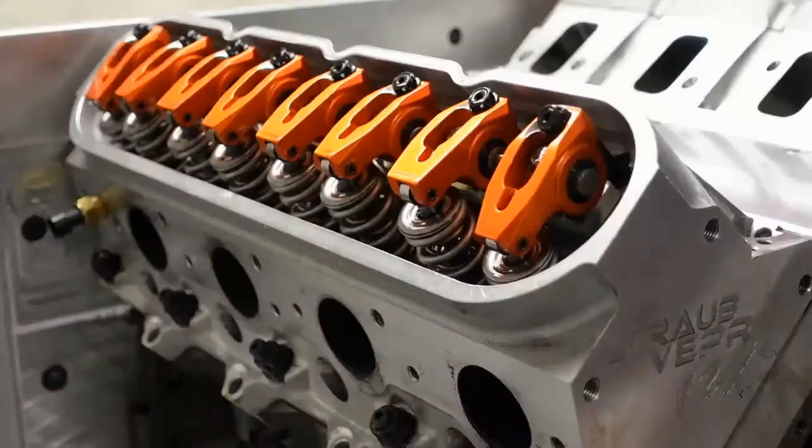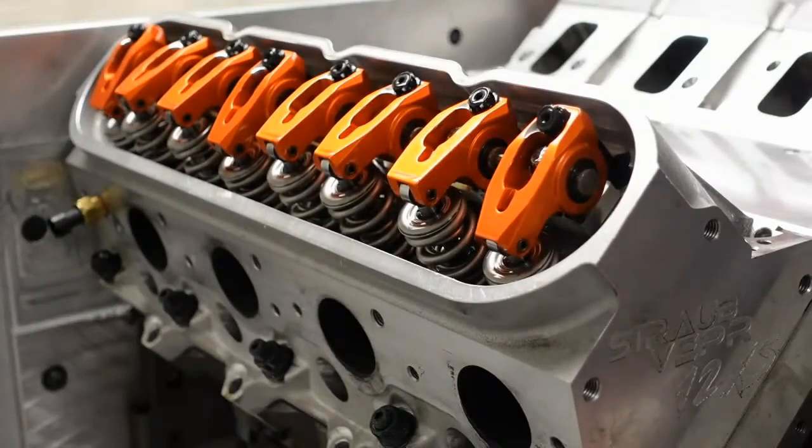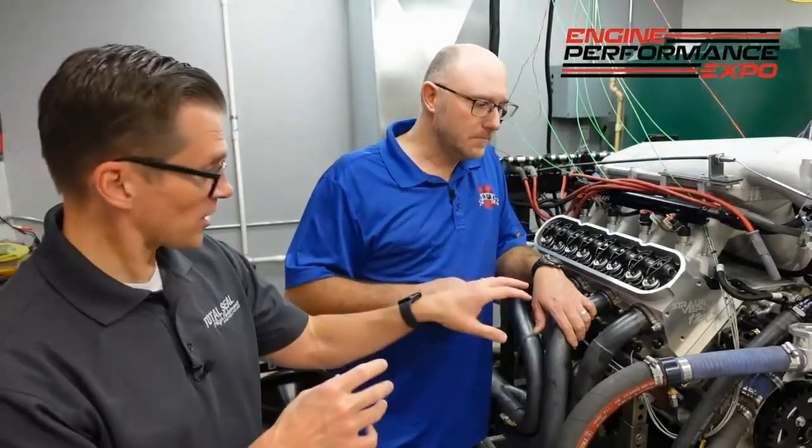What we suspected was the old system wasn't stiff enough. So we did the total system stiffness testing as in the other videos — checking the difference in total valve lift between the checking springs and the real springs to see how much deflection there is. But in reality, we found there wasn't actually that much difference in the actual total stiffness of the system.